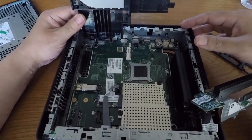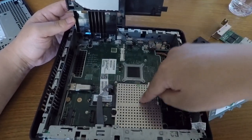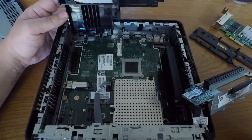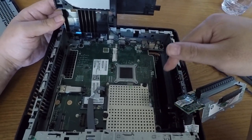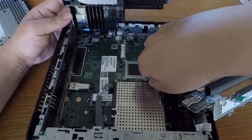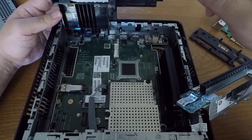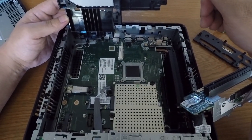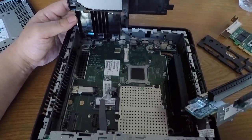This really is a nice little system with a lot of expandability — between the two internal USB ports, the mSATA, the M.2, the onboard PCIe, and the full PCIe slot through the riser. Under the panel there are two SODIMM slots with a maximum capacity of 16 gigabytes, so you'd need two 8GB modules to max it out.